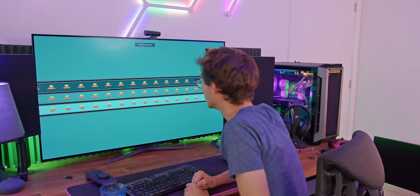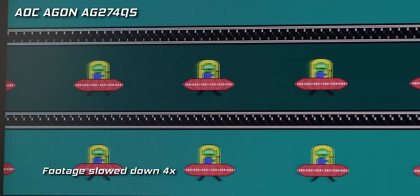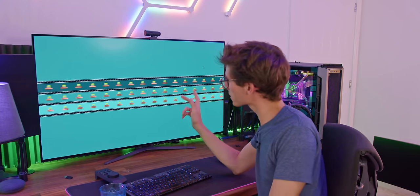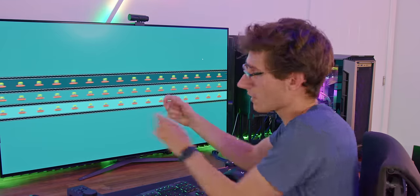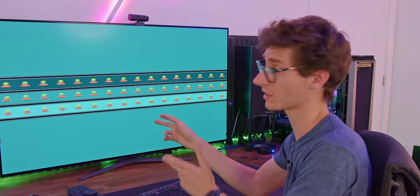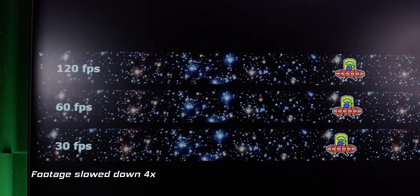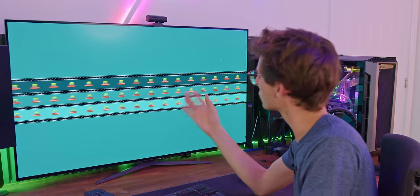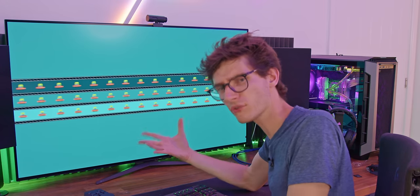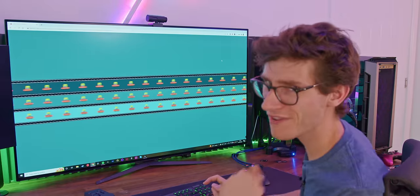It says there 138 — magical 138Hz. Let's do our favorite test with UFO Test, going to the ghosting test and making it full screen. That does look very, very crisp, but it's not quite as good as the 300Hz 1440p monitor I tested. The motion blur you're getting from the panel refreshing is really low — this is the beauty of OLED. I think it's about 0.1 milliseconds to actually transition from one frame to the next. However, because this is only 138Hz compared to a faster monitor with more frames per second coming in, it's not quite as pin sharp. But the amount of blur is minimal — it's sharp and blur-free, just not as smooth as if it were 300Hz. It's still very, very impressive, and it's slightly faster than an LG TV.